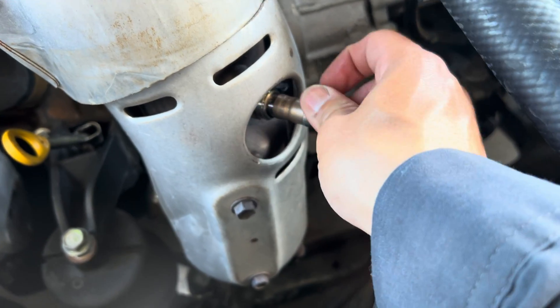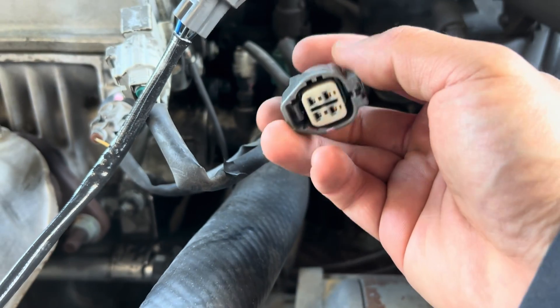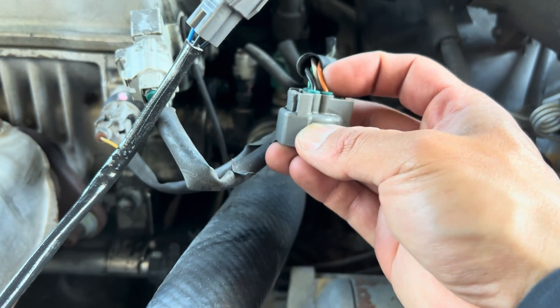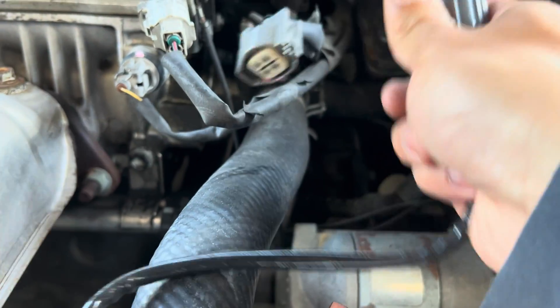It's smoking. Now I've got my new air fuel ratio sensor in already — tightened it down. Check the connector here. Make sure there's no damage inside, no pin bent or corroded. Check the wires in the harness — make sure there's no rip or broken wires. It's good.